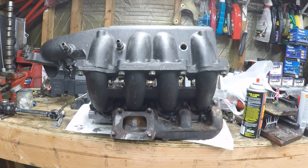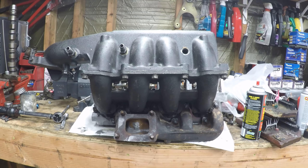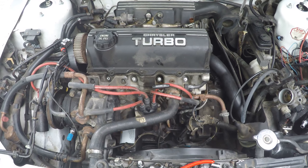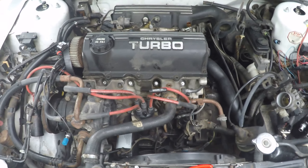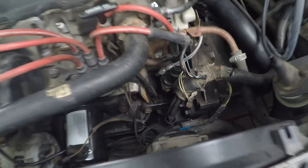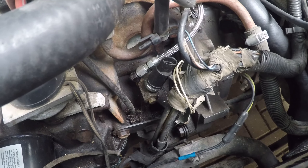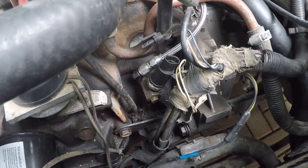It should make plenty of power and be a lot of fun to cruise around in — most importantly, have that AC rolling. Honestly, it could have quite the luxurious ride that could outperform the BMW 5 Series back in the day. We've got pretty well everything off the head that needs to come off, except for the oil feed line. That's a real pain because you've got to pull out the oil pressure sensor in order to get the oil feed line off — kind of a downer. I've started doing these things differently now, so this will be one of the last cars I'd do like that.